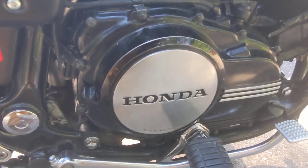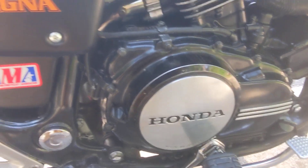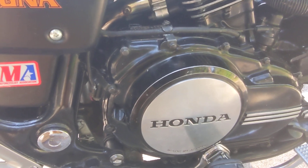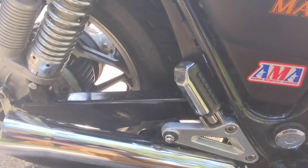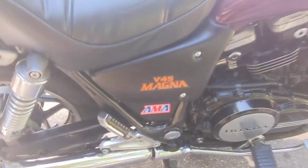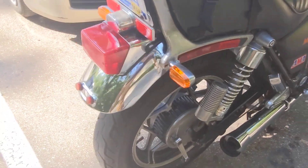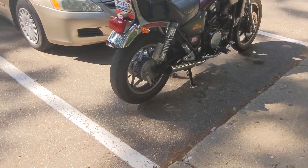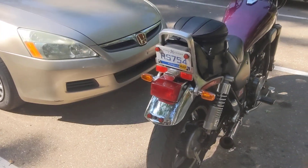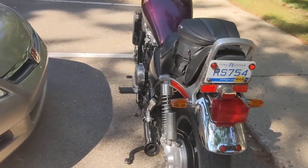I did check the oil today. It was a little low, but that's pretty common for synthetic oils, especially switching over an engine. It eats up a little bit more than usual the first couple oil changes, so I'm not too worried about that. The bike's not smoking or anything when I'm riding it, so I don't think it's an issue otherwise.